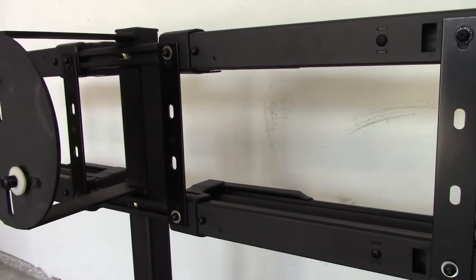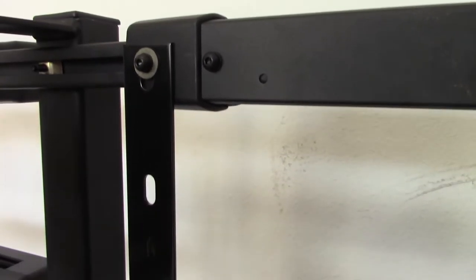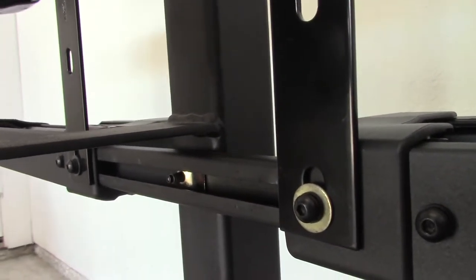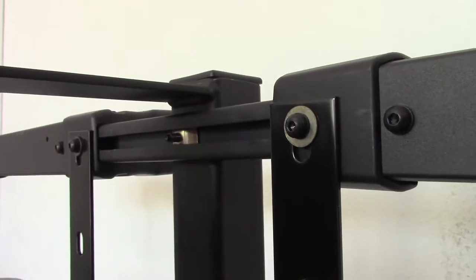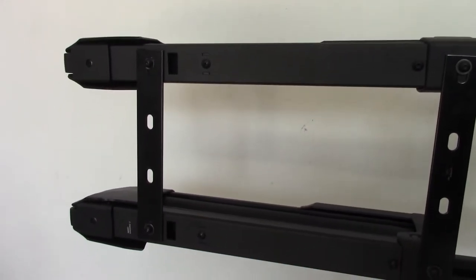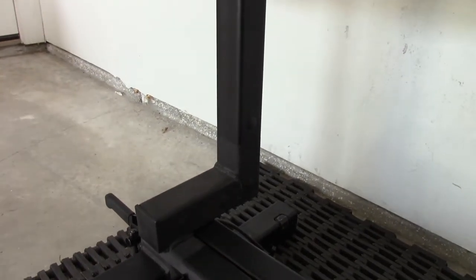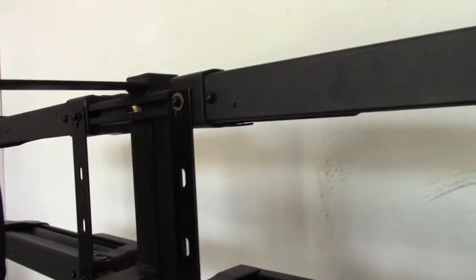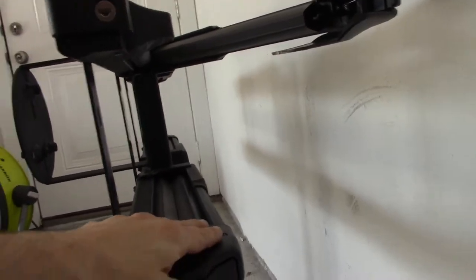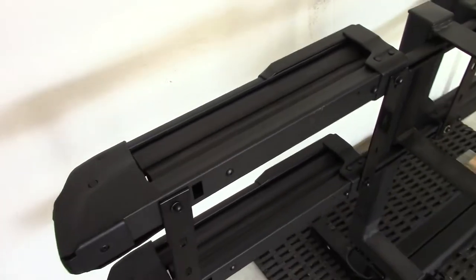This is the finished product. Sorry for the parts that are missing — I didn't quite get it all on film. The vertical brackets are just some brackets I found at the hardware store, and the bolts holding them in are actually the bolts that came with the rack. Normally those bolts would be used to attach the brackets to the cross rails on a roof rack, so that worked out really well. I also ended up trimming some of the plastic off of these pieces right here, because that plastic normally would fit into the mounting bracket, which I'm not using, so I just trimmed that off, which allowed the bracket to fit better.